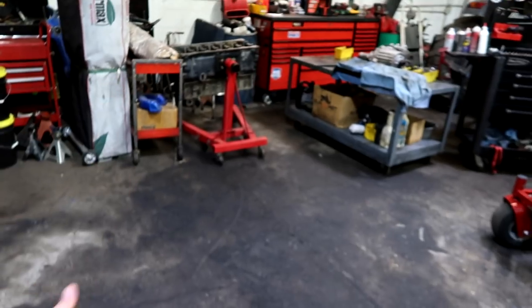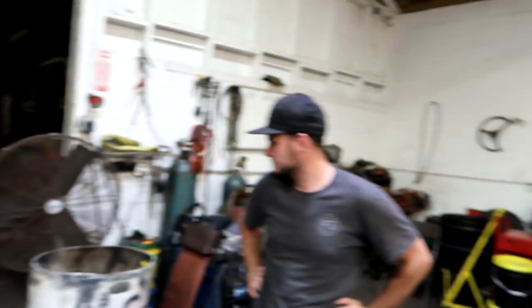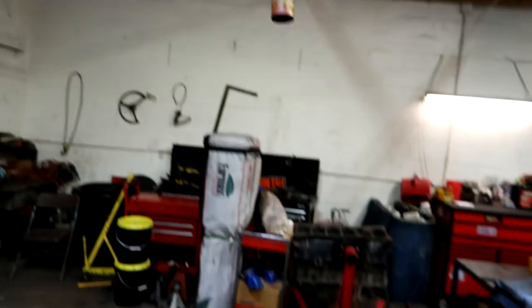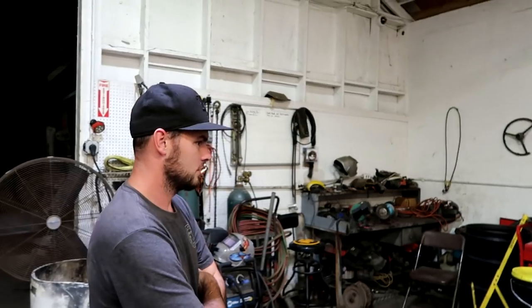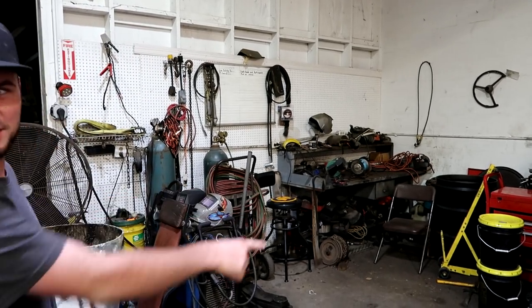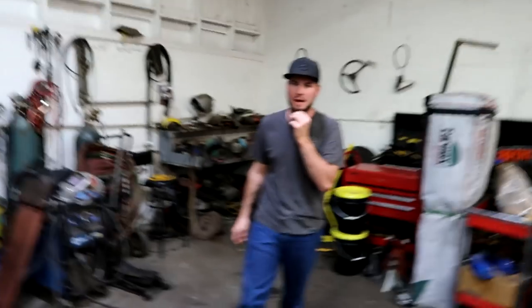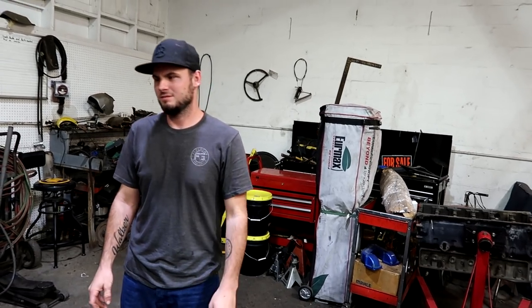Welcome back to the channel. I've got old Halfway here with me. We are in the lawnmower shop. I've got a spot cleaned up right here and we are going to be pulling the rear axle out of the five-ton Rockwells. We've got the chain fall right here in case we need it. We're going to be de-braking it — on mud trucks you don't use drum brakes, so you call it a driveline brake. We'll get into that, but for now we're going to get on the forklift, get the axle brought in, and set it on some blocks of wood. We'll also need to get the torch out because we have to cut the backing plates off. The backing plates aren't bolted on — they're riveted on.